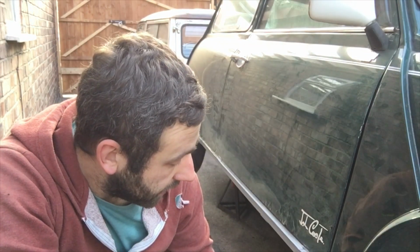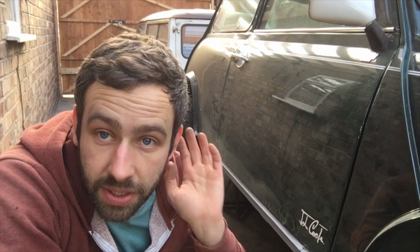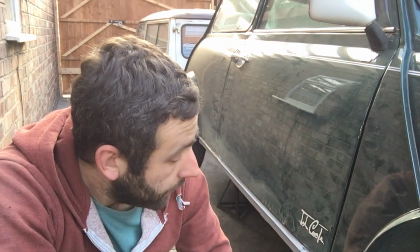The passenger side doesn't look half as bad, and these Emerson sills are really nice. They're as thick as a heritage sill. You've seen I've painted them all inside. Everything's seam sealed inside the sill, so we shouldn't have any of these issues for a long while. The car just needs wax oiling once all the paintwork's done. But hopefully we're coming into the better weather now, and things like this shouldn't be an issue. So hopefully that is a job off the list.